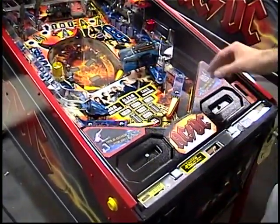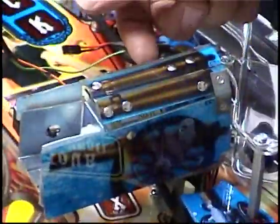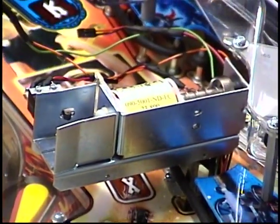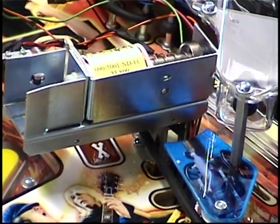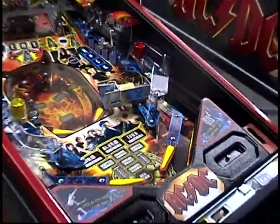I have it turned off. There'll be screws along the bottom. There'll be 2 on this side and 3 on the other side. Once you remove those, the cover just comes right off, so you can store that somewhere. Alright, the next thing we want to do is actually mount the controller box inside.